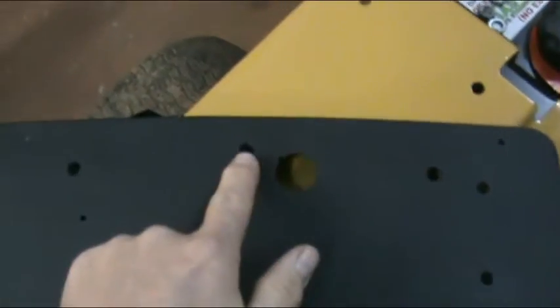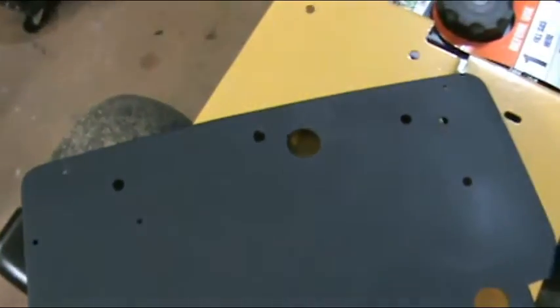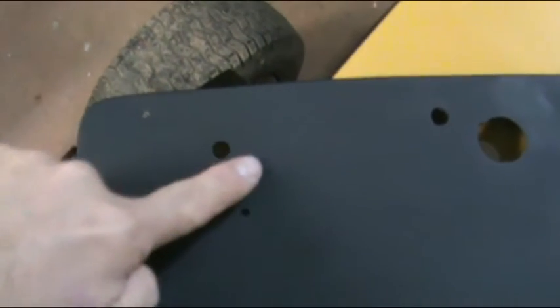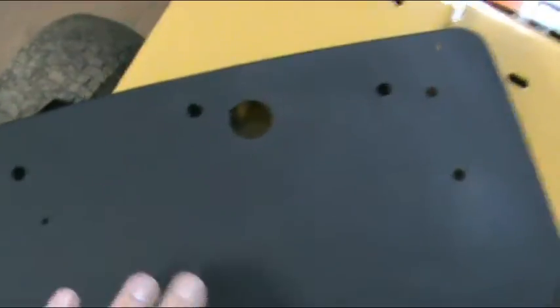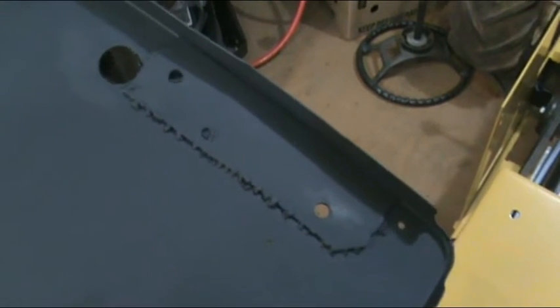Also on this firewall, the support mounts here, here, and here go back to the dash and up to the front of the grill. It's a support rod I'm going to have to make custom — I can get the metal from Tractor Supply, cut it, bend it, tap it, and do everything I need to, because the firewall is sitting back an inch and three-quarters further. The metal around these supports is usually cracked, but on this particular firewall one was good. I took my little body hammer and tapped it all back into place, welded it up on both sides, and on the back side I welded in an extra piece of metal to give it a little more support — nobody will ever see that once it's in place.